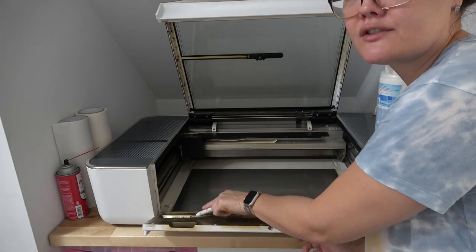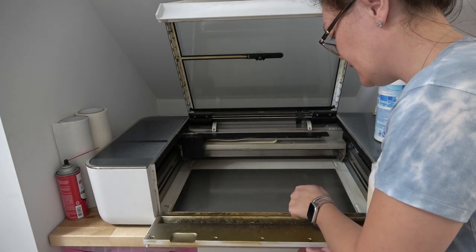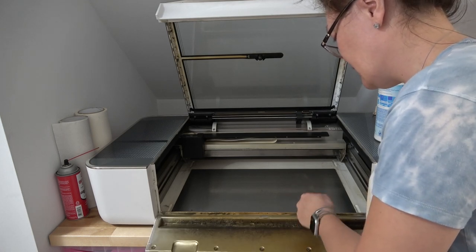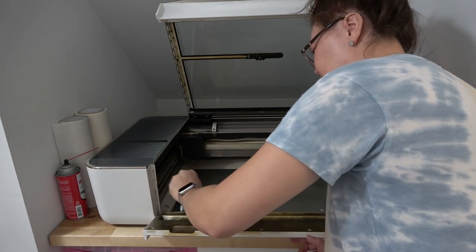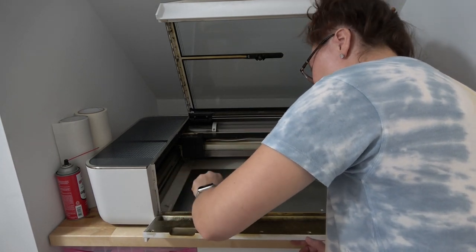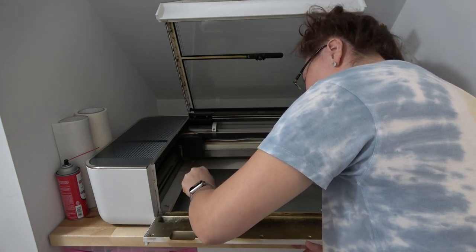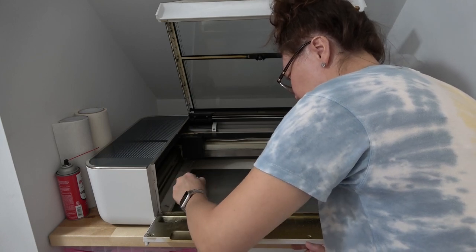You have little notches and channels in the base for your crumb tray — make sure those channels are cleaned out and that there is no extra debris where the swing arm needs to go. If it does not freely move back and forth, there's something in your track and you need to make sure it's clean. Also, inside the door there's a little lip where things can get pushed down. I just take my little weeding tool and fish that out, because it can make your door not shut appropriately.